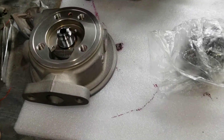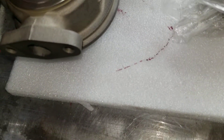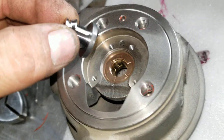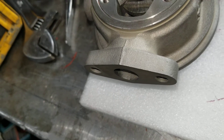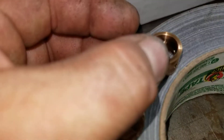Ready to go back together. I already started the back together part but I figured I'd shoot a video of this side of it. So get the thrust, inside thrust in, bushings in, new C's in with the stamping correct facing the right direction so it doesn't cut the bearing like this one.